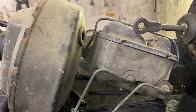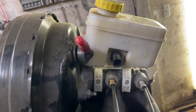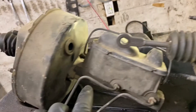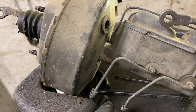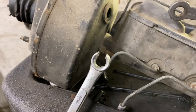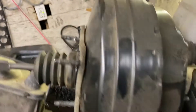That one has the old cast iron reservoir; this one obviously has plastic, a little bit easier to see. This low level is here where the brake pressure warning is on the prop valve, which I'll show you in just a second. It's very important that when you're trying to get these lines off, you use a line wrench. If you use just a standard open box end, it will round those over. They're just brass and they do round off very easily.